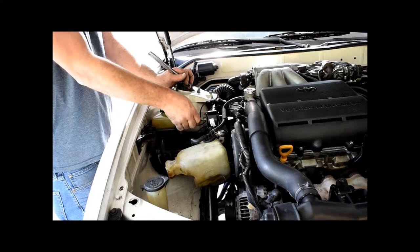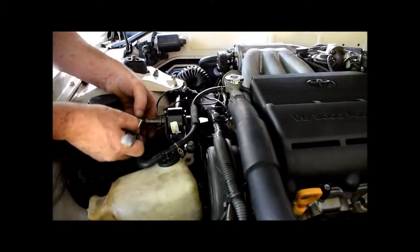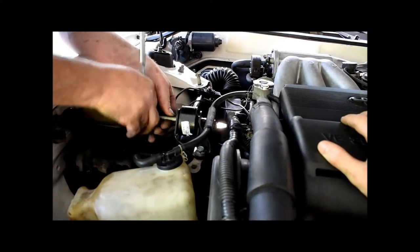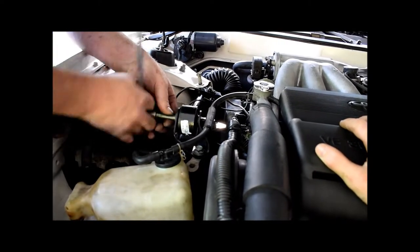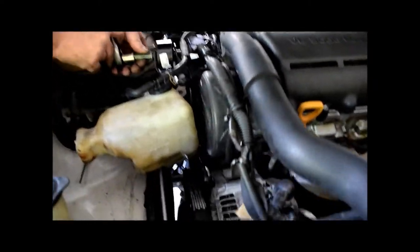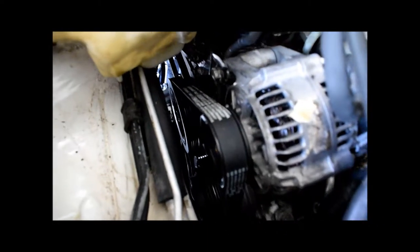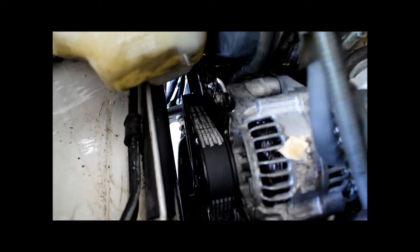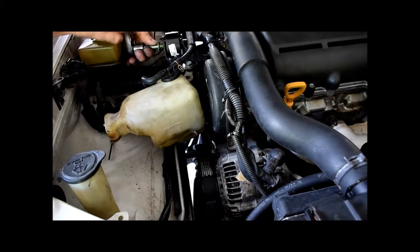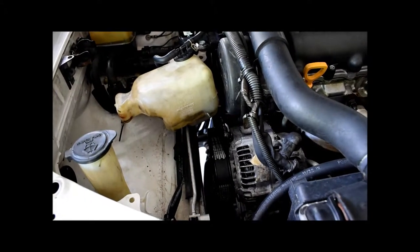There's obviously some pressure on this mount because the back bottom mount is destroyed. The number one reason for failure of the motor mounts on these engines — which they're notorious for — is oil seepage and leaks. Last week we pulled all this apart, changed the timing belt, pulled the cam gears off, and replaced the seals behind them since they're notorious for leaking. So is the crankshaft seal — we replaced all three seals on that, and while we were in there we replaced the water pump.